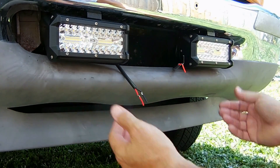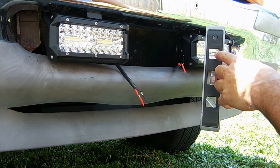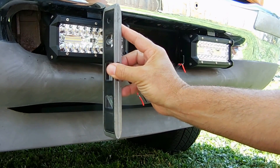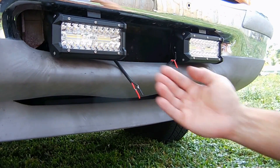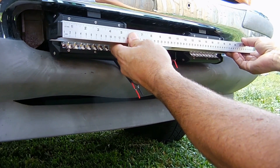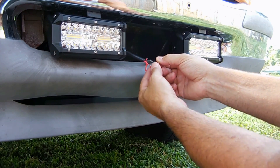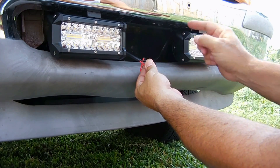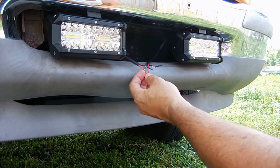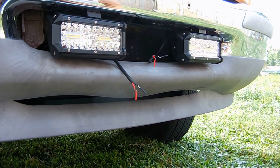The installation of both bar lights is now complete and everything is securely tightened. To make sure they're on the same angle, I took a torpedo level, looked where the bubble lines up, held it on the face of one, then went over and made sure it matched on the other. I'm going to take the two black wires and solder about a six-foot section of black wire onto them, put a ring connector on the end, and attach it to chassis ground. The two reds are going to have about a 12-foot section of 18-gauge copper wire, routed all the way around the fender with nylon ties, and passed through the firewall.